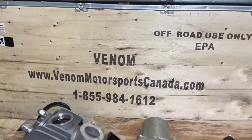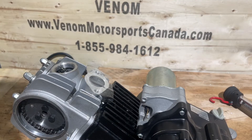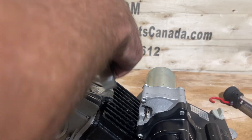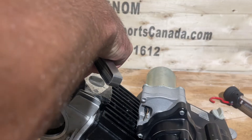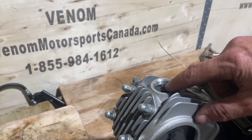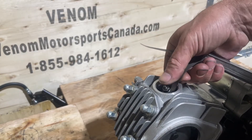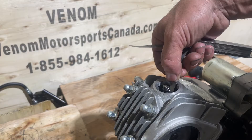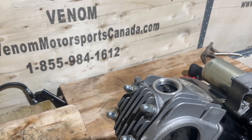Your intake right here is going to be 0.004 inches - like that, and that one's perfect. You want to be able to slip the feeler gauge underneath the valve guide. You don't want it so tight that you can't get the feeler gauge out - that's way too tight. You just want to be able to slip it under there with no play but easy to slip in and out.